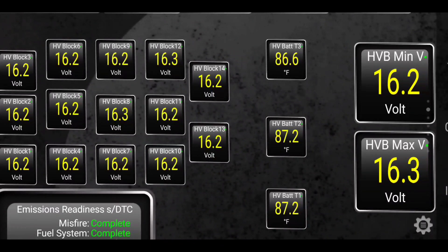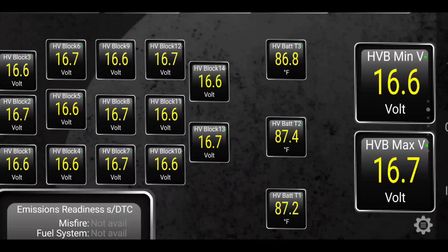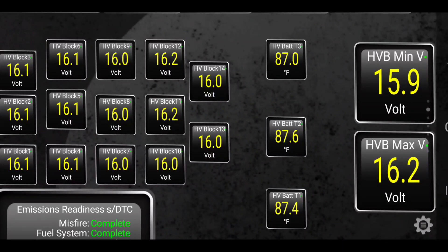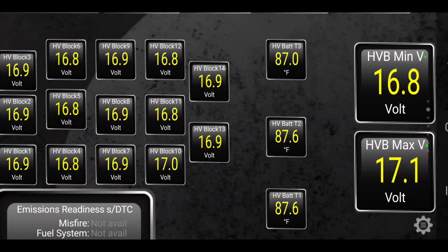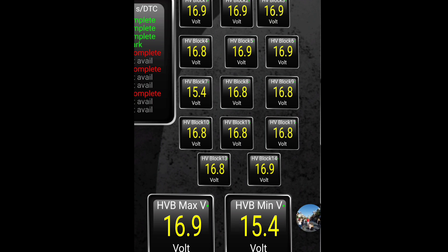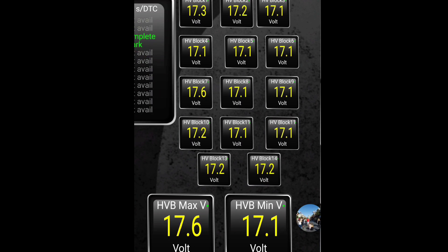We're driving the car down the road. We've got a couple of measurements coming up — high mileage for just driving around town, taken with the engine already warmed up while being careful. You can see the voltages are great here. Notice the three temperature gauges there as well. This next video is the original nickel metal hydride — you see one of the voltages there that looks like block seven was giving me issues. I'd already replaced two or three cells, and it just gets old pulling the battery apart and putting in a new cell.